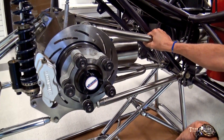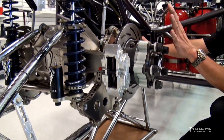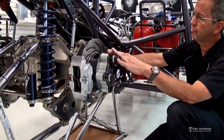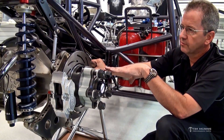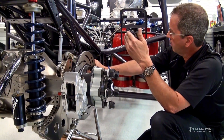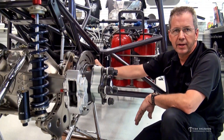That's a real good indicator if you forget which way negative and positive is — just look at the housing and see what it does. If the car's going left, the right rear tire has more traction and more weight on it than the left rear. To get away from that, crank on this bar and change it one flat at a time. If you can't remember that negative pushes the car back to the right, just give it a turn and watch the housing. Stand behind the car: if you want the car to go right, you need more traction on the left rear tire — putting negative in gives you that effect.